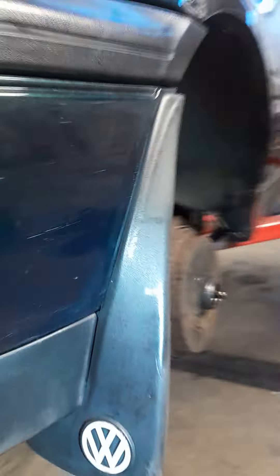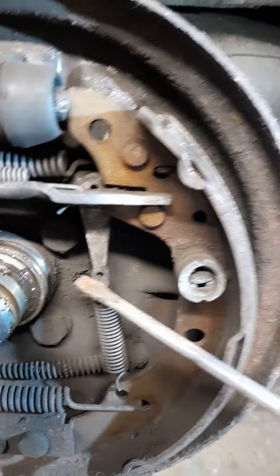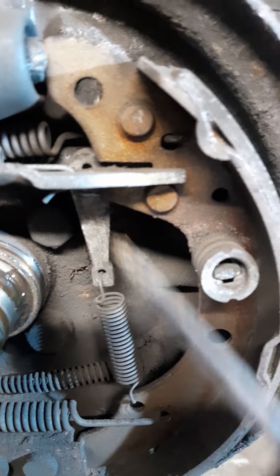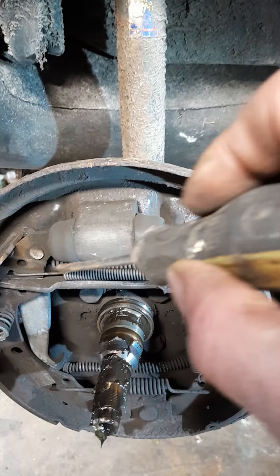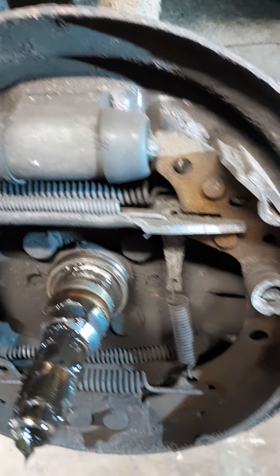So bear with me on an attempt. You're going to be going in here underneath the little thing and levering up. I'll show you now — hold on for a second — this chap here. Okay, and when you've got your screwdriver through, you are levering this chap up. By levering this chap up that releases the pressure and the adjuster. So you're sticking your screwdriver in underneath and levering that chap up, and that will release the shoes and let you take the drum off. Hope that helps.